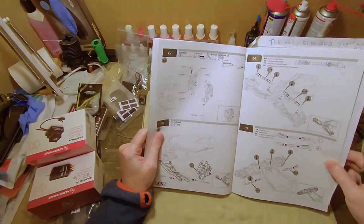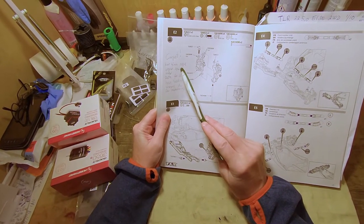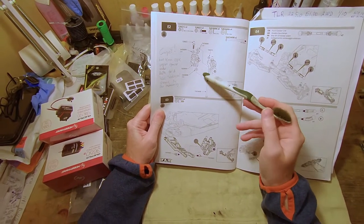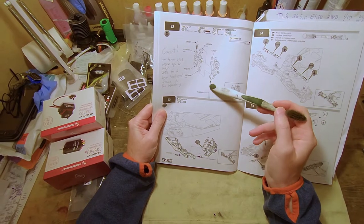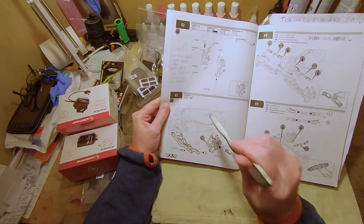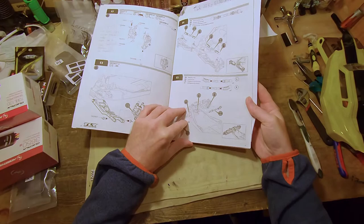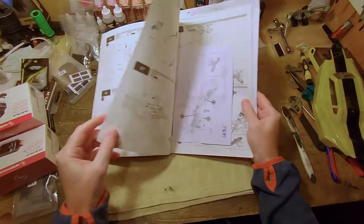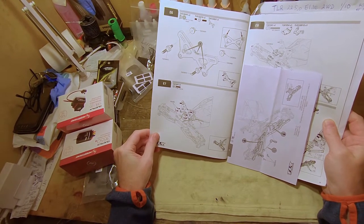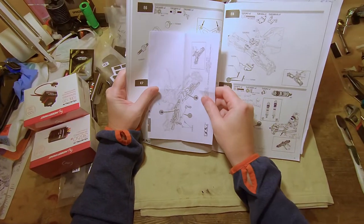I hope I'm saying it right, but I'm sure I did just use spacers here, 4mm on the upside. On the kit, they are using 2mm on the upside and 2mm at the bottom. Again, this is also to get a better setup for the carpet. And then it goes on here, and I think I just stayed with the kit setup shock positions here. I didn't see a big difference in the carpet edition.